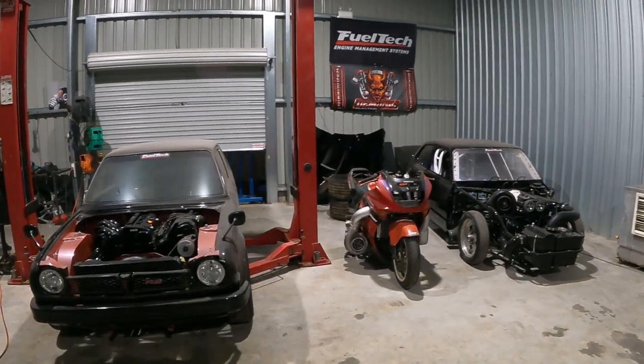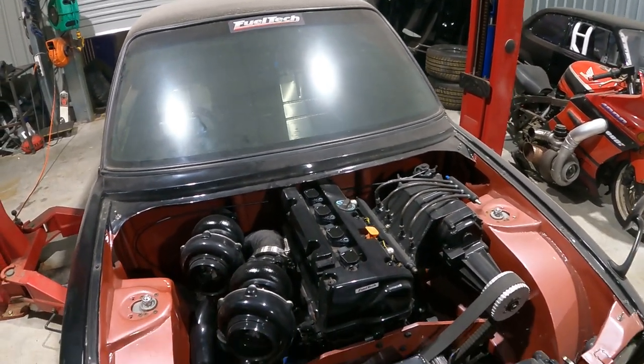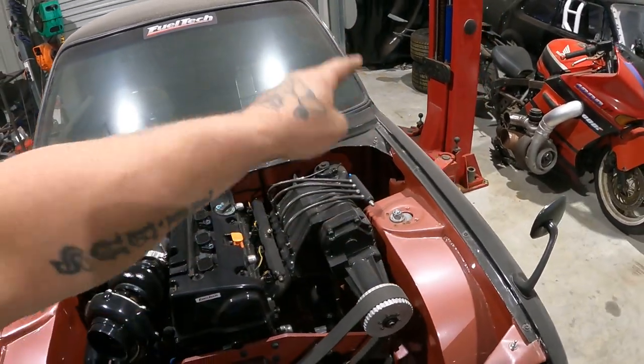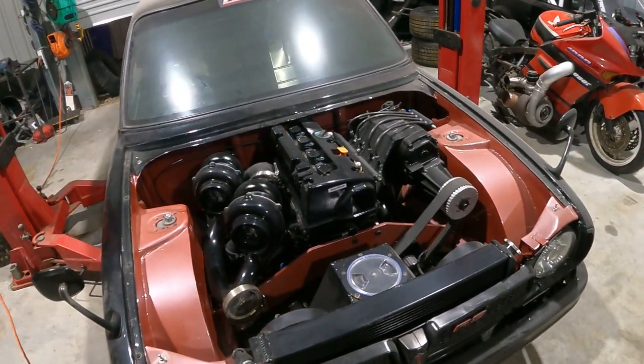I love the idea of fewer switches - start button straight off the ECU. Even on that one I'm going to have the light buttons actually on the ECU as well - I think that's going to be an awesome idea. I'm going to try to incorporate some cool features. I'm going to try to go with the FT550 or FT600 - see which features suit because they've got more inputs and more outputs. Also we can run the K20 in sequential mode, so once that's running sequential that'll be a little bit better. And we've got nitrous on this as well, plus an electric water pump and thermo fan - more electric things to control, so that's going to be good.